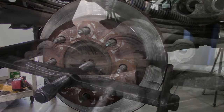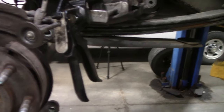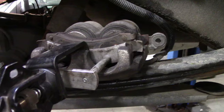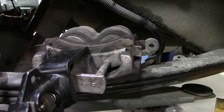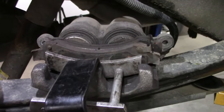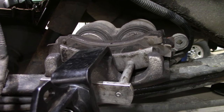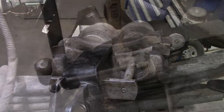We're gonna reset these brake calipers. I've got my tool all set up here - kind of looks like a caulk gun. You just squeeze the handle, a little lever pushes in, pushes the calipers back in. Now these are push-in style - they've got all different styles, you know, twist-in and all kinds of stuff, so make sure you do the right method. I do have a couple of the old brake pads in there just to take up space. I'll get them squeezed back in and we'll move on to the next.